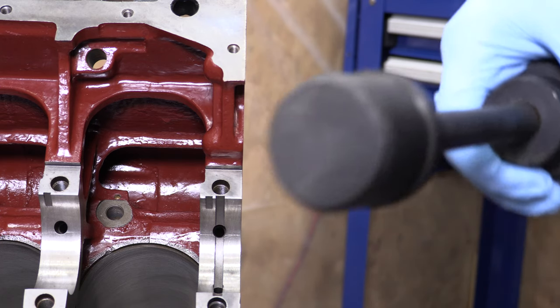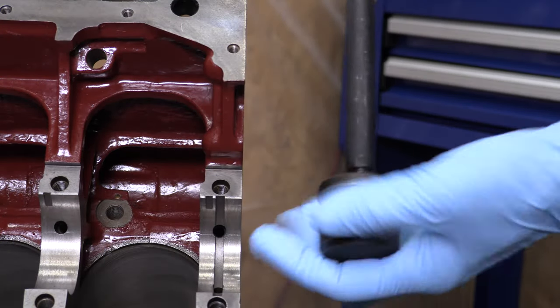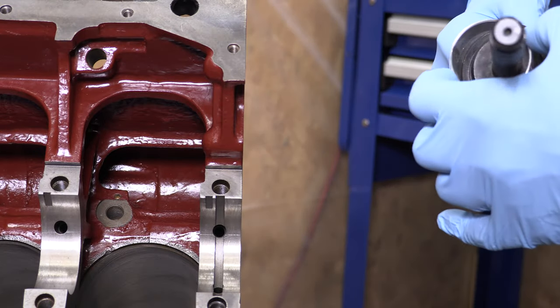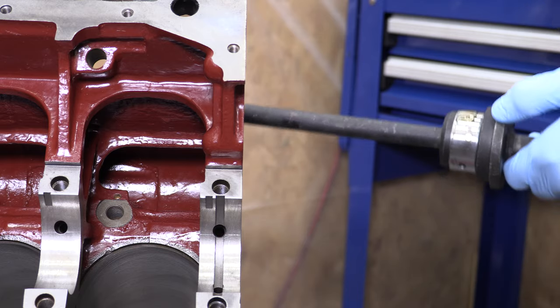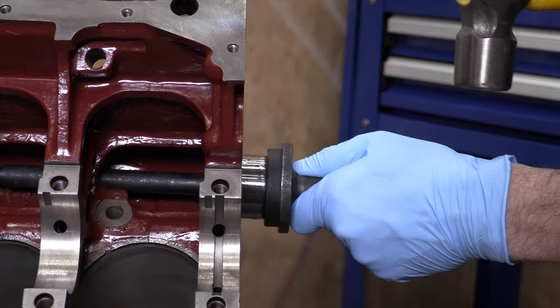to the missing balance shaft. You also use the same tool for the front race, but it works a little bit differently. You unscrew the rear bearing driver boss, and now the front bearing fits over it. You get it lined up, noting the oil hole location, tap it lightly a few times to get it started, and then pound it home. When you get to the end, you get that familiar clang.